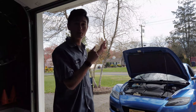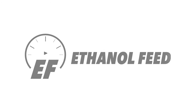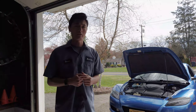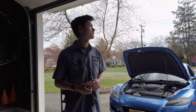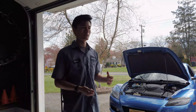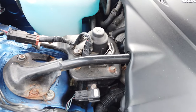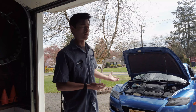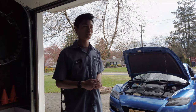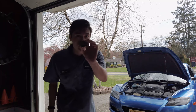What's up guys, so today we're going to be doing an air pump delete. Our cars come stock with a factory air pump, secondary air injection as it's otherwise known. Pretty much what that does is it pumps some air into your catalytic converter when your car starts to get it working sooner, and that way it filters out all the bad air. But I don't have a catalytic converter so I don't have a need for the air pump. So today I'm going to be taking that out and all I need is this little plate right here.